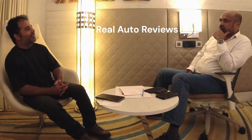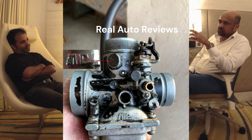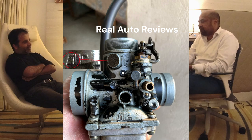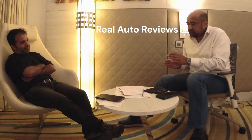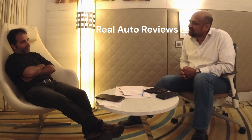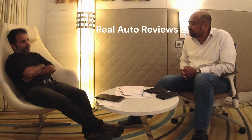The Indian RD350 carburetors - the so-called famous Japanese Mikuni made-in-Japan carburetors - if you look very carefully, the MIC logo is chopped. There is a casting feature which had been used on some later bikes for adjusting the slide. The M is missing. OEMs generally don't do that; if they have to modify the thing, at least they will remove the logo. This suggests our carburetor is unique. Most probably Yamaha took the spare development tool, did the modifications required for India, and gave us made-in-Japan carburetors. The biggest clue is that MIC logo being compromised - the M is missing - and that cast window feature confirms the tool was unique.